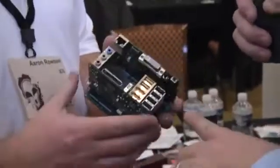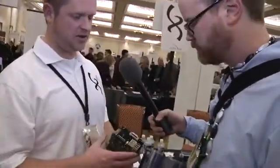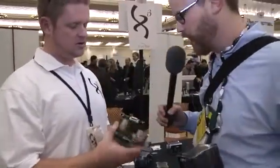Your Southbridge is connected with the PCIe lanes. This is the power supply board — we have power and video options. We actually have a separate card that has other video options on it. And then this is what we call our backplane — this is all your I/O. As new technology comes out, like USB 3.0, we'll release a USB 3.0 backplane for around 50 to 100 bucks. So you don't have to upgrade your whole machine — you just buy a card, slap it in, and you're upgraded.